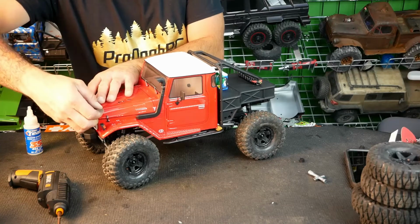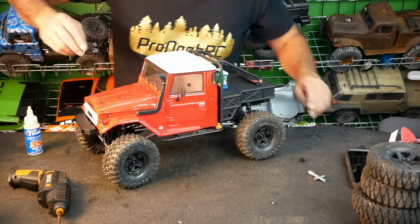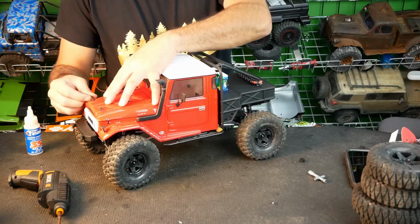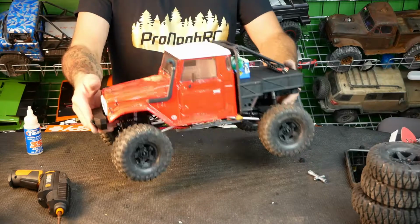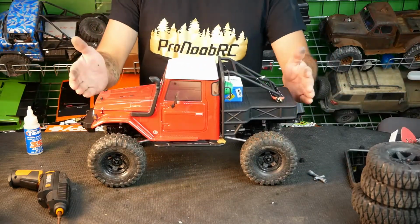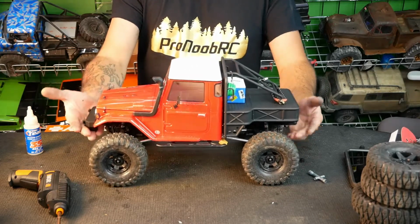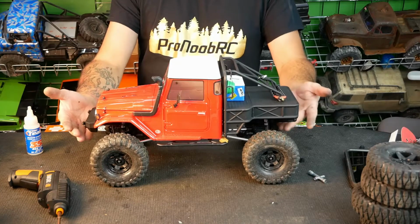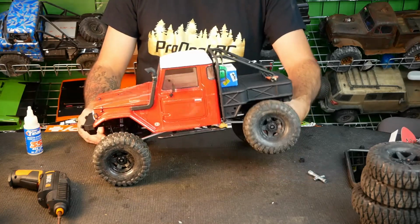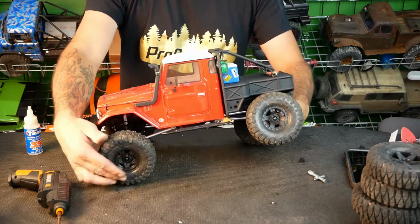Okay, well, that is where we're at on this one for now. We're going to get out, play with it, maybe get some lighter springs in the front, but they were 80 millimeter shocks. The way it sits right now, we put a 10 millimeter spacer in the front so it can't droop anymore on the front suspension. The rear still has that little bit of droop we left in it. We're going to leave that to give the back end a little more articulation than the front.